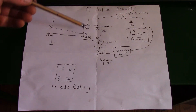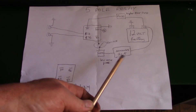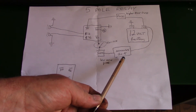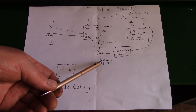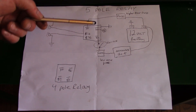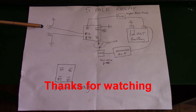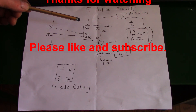This main battery power does not get connected to the lights until the switch is triggered. The switch is fed from your keyed 12-volt accessory line — any positive keyed-on source. This side only needs a low-amp fuse, like a 5-amp, just to activate the relay coil. That's what feeds power from the battery to your lights. And of course, don't forget your ground. Note that on some relays, pin 86 may be labeled 98. That's how you hook up an accessory using a relay — good luck!